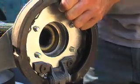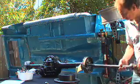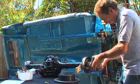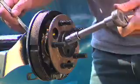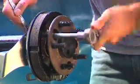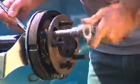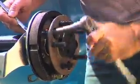Slip on the mounting plate and just hang it on the bolts for now. Slide in the axle and locate it in the spline. You might have to jiggle it a bit to do that. Then line up the bearing with its housing. As you tighten up the bearing retainer plate, it'll pull the bearing right in home. Tighten the nuts to 30 foot-pounds of torque.